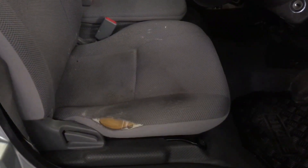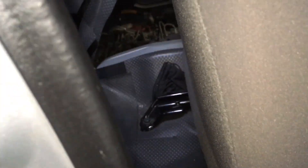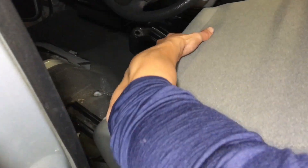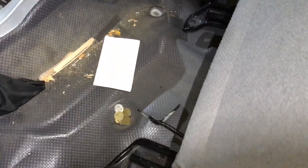Alright, so it's a Hi-Ace. First thing we're going to do to make a bit of space, let's rip these seats out. There's two bolts out the back of the seats there. Two bolts at the front, two bolts at the back and out she's going to come. Just lift the whole thing out of the way. Don't forget the wires — disconnect the good old wires.